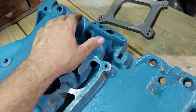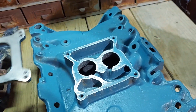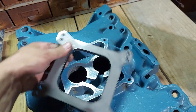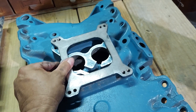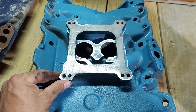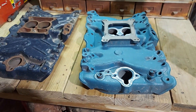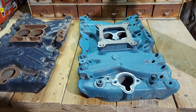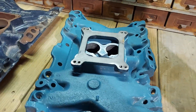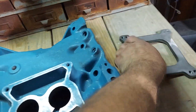If you want to use a carburetor, you could get a four-barrel flange like this one. What you'd want to do is grind out the center of this flange completely, then fairly easily mount it here and put a square-bore carburetor on — like a Holley or Edelbrock square-bore — for a four-barrel carburetor with more flow. That would be good for a high-RPM intake, like for racing. It would also be lower profile than high-rise single-plane intake manifolds, so it'd make a good sleeper high-RPM intake if you wanted to convert it to carburetor.